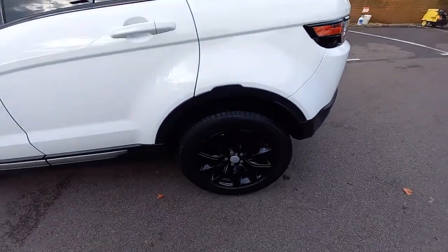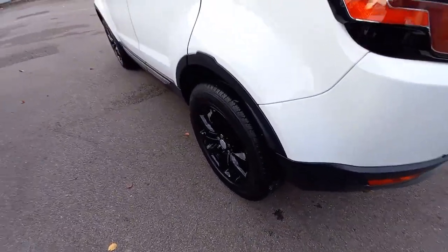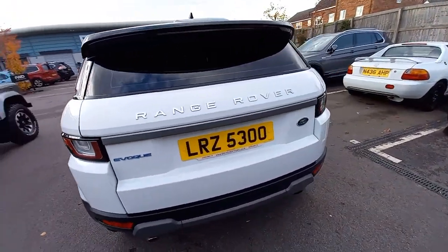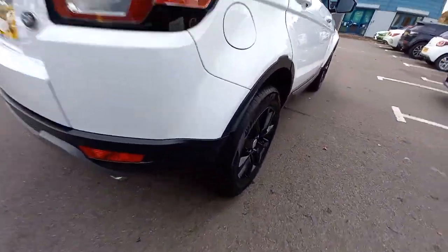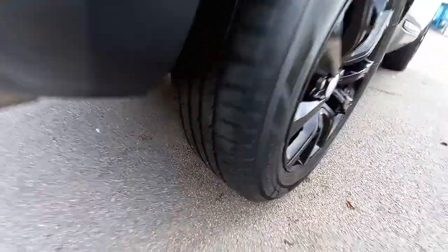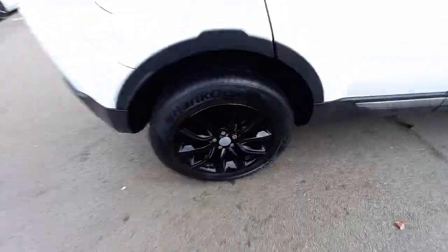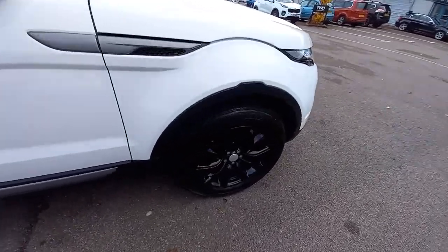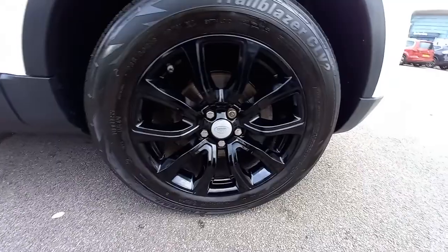Really, really good condition. The tyres are really good — all four tyres are above 5mm. The new tyre tread depth is 7–8mm, so these are all 5mm or more. All the wheels are in very good condition as well; they're not scratched at all, partly because they've got the bigger tyres. These are actually 18-inch wheels.